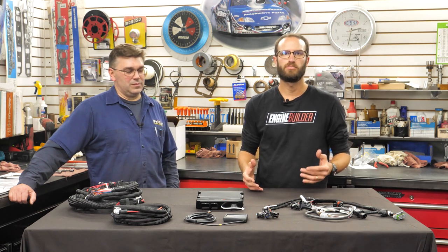This unit has four different inputs and four different outputs for things such as additional pressure sensors or activation triggers for nitrous or a trans brake, as well as accessories such as fans, boost control, nitrous control, and more. In addition, Terminator X offers several advanced tables, integrated data logging, and free EFI tuning software.